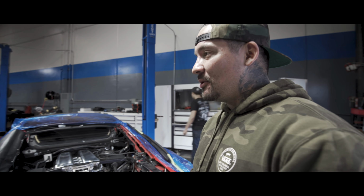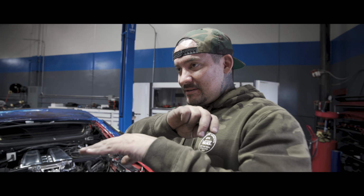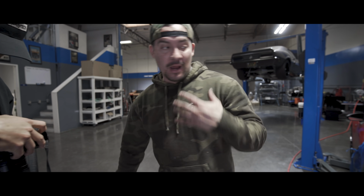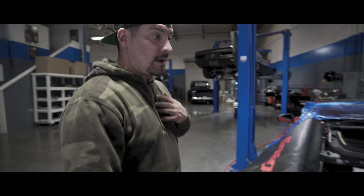But they have a great program, a great tune. It's all in the tune, right? As long as the perfect scenario holds, it's gonna be good. However, if it gets a hiccup at that kind of power, detonates or something, and knocks hard enough, it's gonna throw a rod. So that's why we don't run customers' cars that hard. I'll run my own car that hard. If a customer wants it run that hard, I let them know, hey, here are the downfalls.